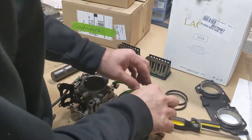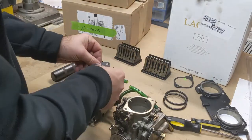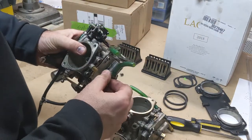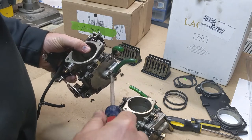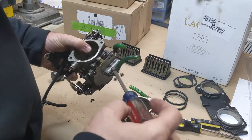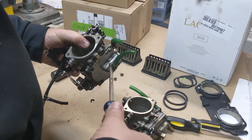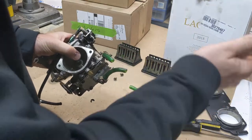Take this off — gaskets. Notice these clamps are looking rusted; that's because they're not stainless steel. So we're going to take these off and throw them away, because we're going to replace them with stainless steel Etiker clamps, which are a lot better for this anyway.